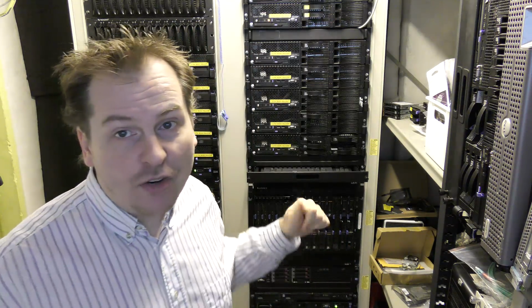But today I'm gonna try and have this Synology box use the Synology Hybrid RAID, which is the SHR. Synology turns this off in their higher level storage boxes when it's like enterprise stuff. They don't want you to use that, and I've seen a lot of places where they say that 8 drives are the maximum that you can run in SHR. But well, I want to try that because I have an 8-bay Synology box at home where I do use SHR, but on this box I want to do 12 discs in an SHR2. That's equivalent to a RAID 6, but with the SHR features.